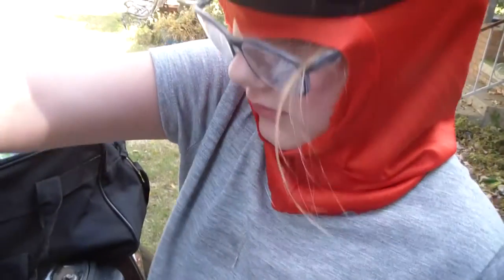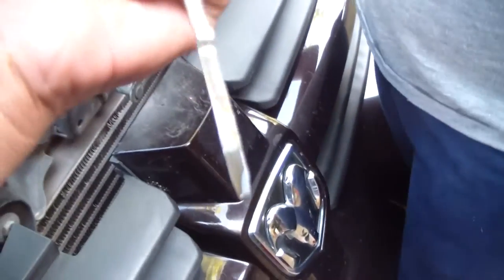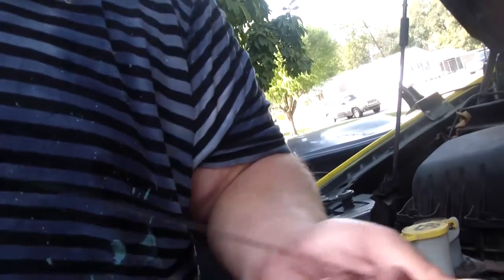You remember how black the oil was that came out? That's because it was really old. I need to change the oil more often. Pull it up. All right, now look at it. We're all the way up. And here, let's turn it the right way. And we are at the safe mark, a little bit below. Wipe it off, make sure it's nice and clean. That way we get a good reading. And we will check. Oh yeah, yeah, we're good. We are good. All right.